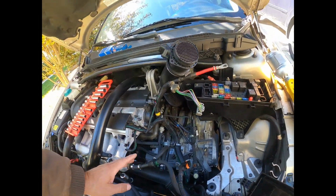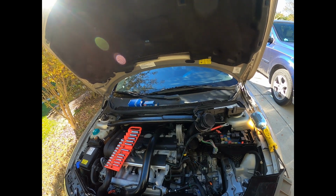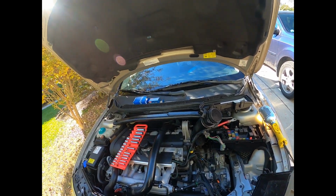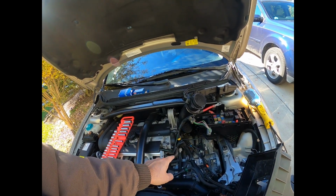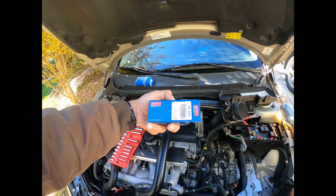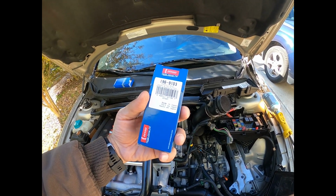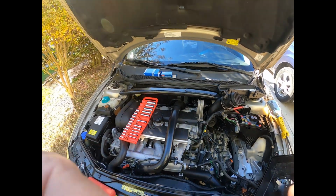Or third, it's the fuel pump, where it can lose pressure sitting and the fuel kind of starts going back and the pump needs time to prime. Most people have problems with that crankshaft sensor, and this has never been replaced. I bought the Denso, made in Japan, from Rock Auto at the same time, and I'm working on replacing that.